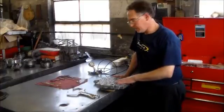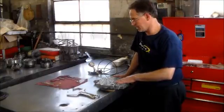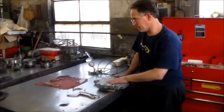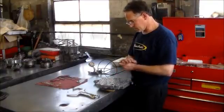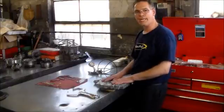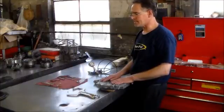What I have here is a valve body out of a 4L80E. I'm in the middle of actually building the trans. I didn't video the teardown because I already have one on my channel. The complaint with this 2001 GMC Savannah 3500 van was that when it gets hot, probably after running for about an hour or so, in the higher gears the customer said it slips.